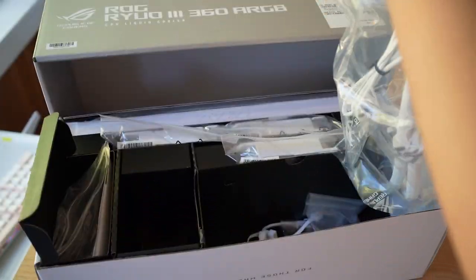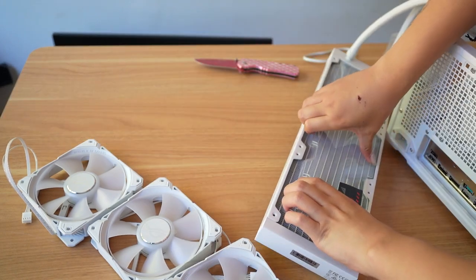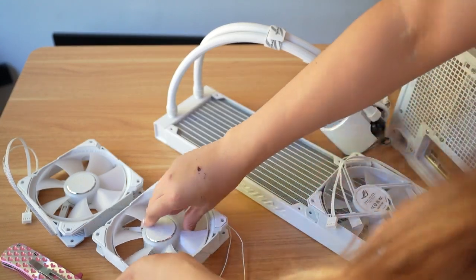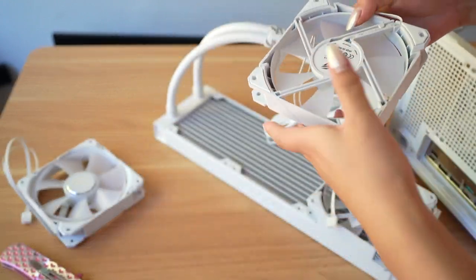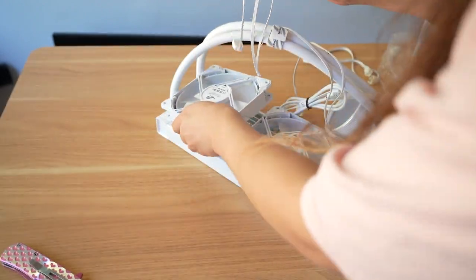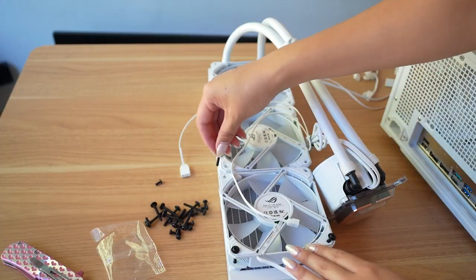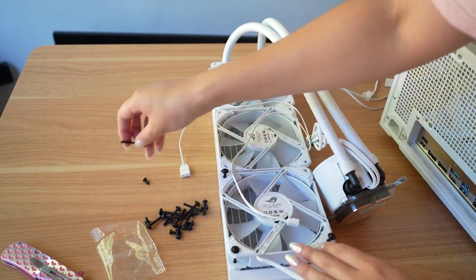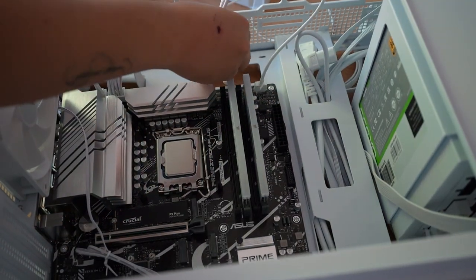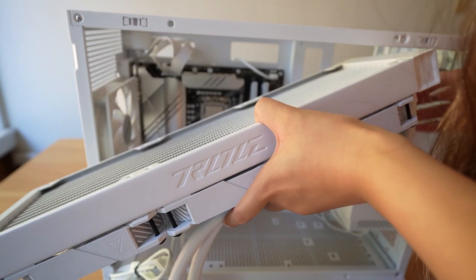It's time to set up the AIO. I've never used an Asus cooler before — they're packaged really well, almost too well, since I struggled to get the plastic covers off the radiator. There are three ARGB fans included; I'm setting mine to intake since I'm not adding any extra case fans. I'm routing cables toward the back of the case for easier cable management, and I'm connecting the RGB splitter to the RGB header on the motherboard before mounting the AIO, since access will be blocked afterward. Now is also a good time to install the fan splitter to the top CPU fan connector.